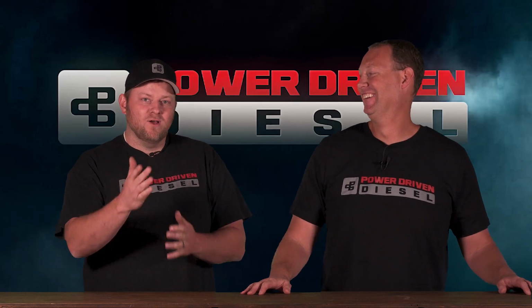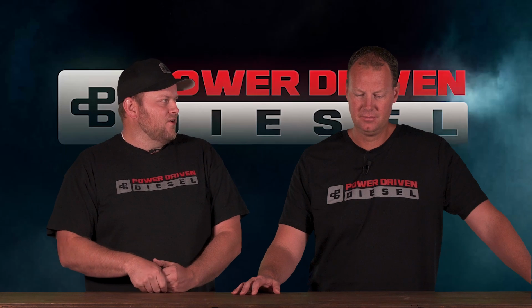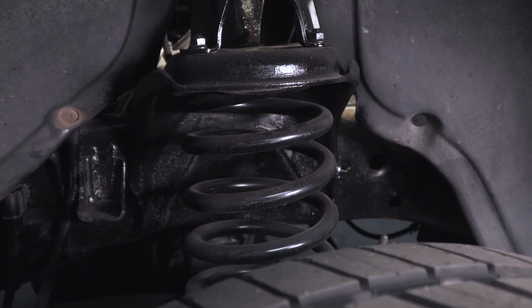So anyways, we didn't want whoever does this, if they race, to do that, so the suspension's upgraded. The other thing is you got to get the stance right on the truck. These trucks don't look great when they're full height. They're way too high. They're a little high. So we lowered the front end, and we got some new variable rate coil springs. Drop it down a little bit.